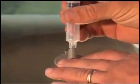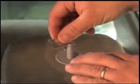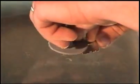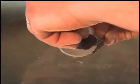After 20 minutes, remove the syringe from the pedestal. Carefully use the safety razor to loosen the outer edges. Then slowly remove the pedestal and adhesive disc from the glass. Wipe off any residual resin from the glass.